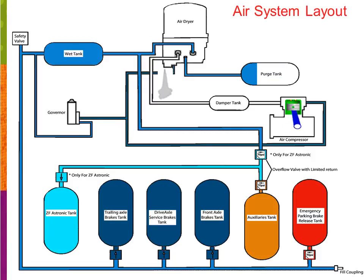During the purging cycle, there's a check valve in the air dryer that prevents the system air pressure from dropping. During this unloaded cycle, the air from the purge tank will have an opportunity to escape out the bottom of the air dryer, and with it pull the impurities trapped inside. Also during this cycle, the piston may be going up and down on the air compressor, but no pressure is being built. As system pressure begins to lower, it'll eventually get to the point where the governor will see it necessary to exhaust the air that was on the signal wiring to the air dryer and compressor, and then once again start the cycle over again.